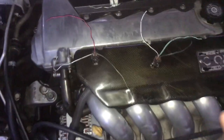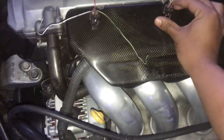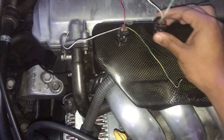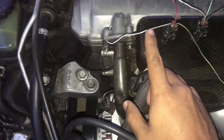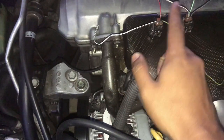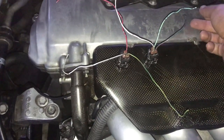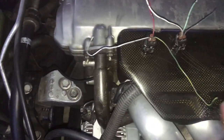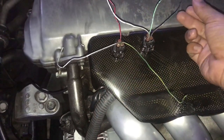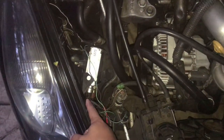To hook up these levelers, it's pretty easy. These are different colors but they're the same plug. The two white wires are your ground. The red one and the light green one with silver dots — that's your power, so that one needs 12 volts. The one on the right is your signal, so those two are your signal wires.